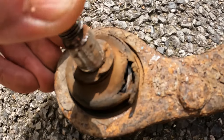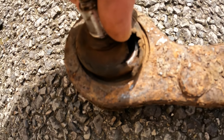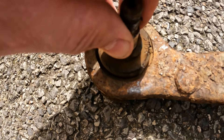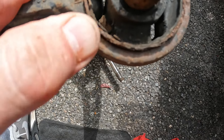Now this is when you can see just how knackered this is. That boot is split and it's bone dry in there — miraculously there doesn't seem to be any play. And as for this bush, that's separating — you can see that's on its way out.